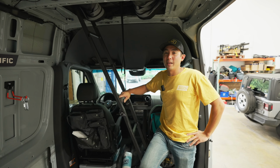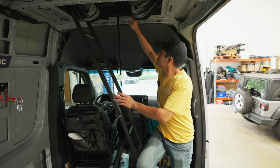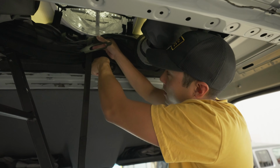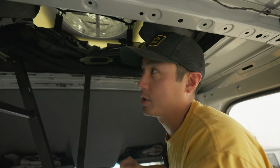So the first step is to unlatch and take the safety off the cover plate for your latch. This safety plate from your latch. Then you're gonna turn the lever 180 degrees, and then you're gonna give it a solid push up, and the gas struts should lift the rest of the tent.